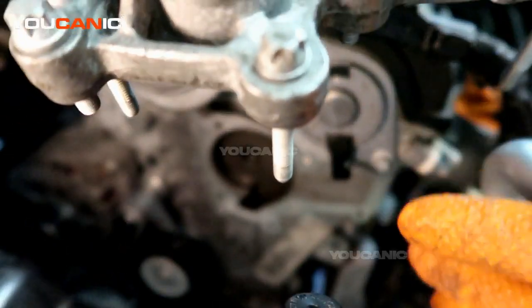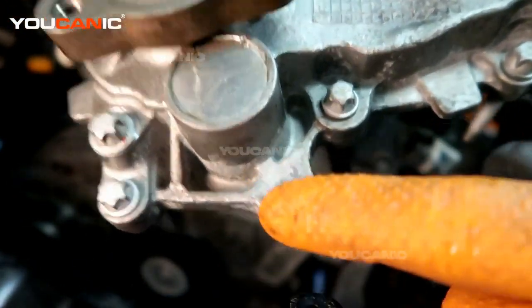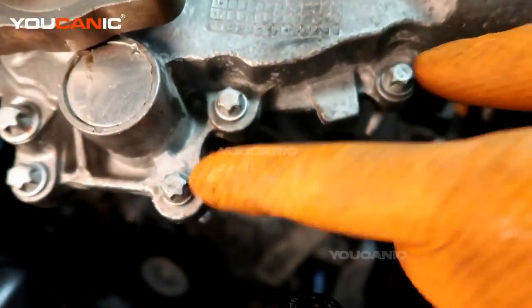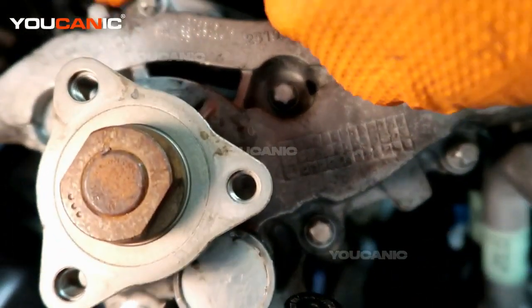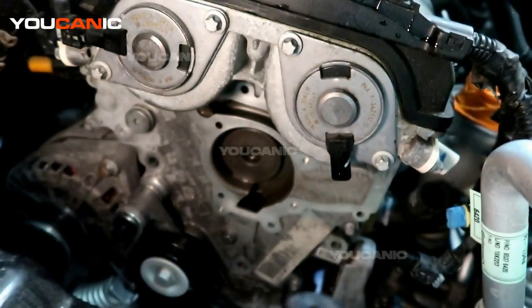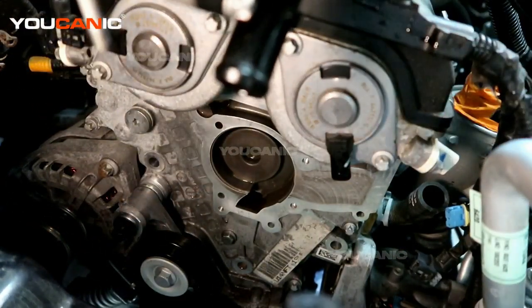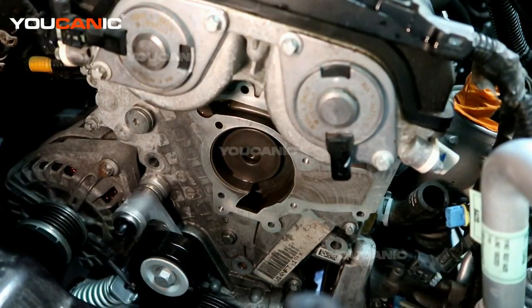That's the removal of your water pump. This is the old water pump — it had water leaking from this pulley area, so it's time to replace it. We have three different sizes of bolts: the two longest go on this side, then three that are a bit shorter, and then five other bolts that are all the same size — ten total bolts hold this water pump on. We have the old thermostat on here, but we'll put a brand new thermostat on the new one. You can attach it before you put it on the vehicle, but we'll just do the water pump first.